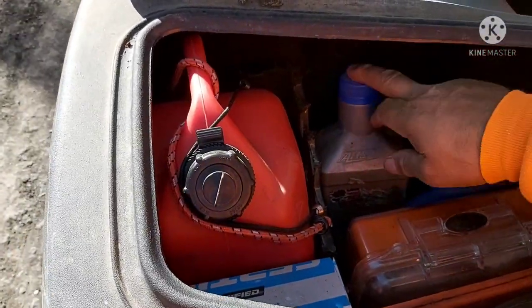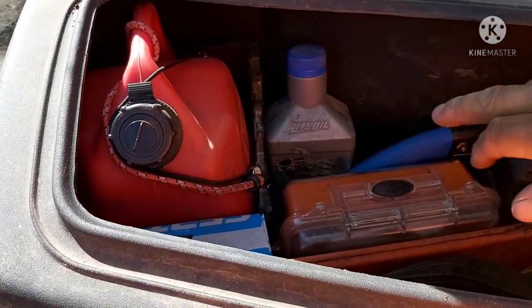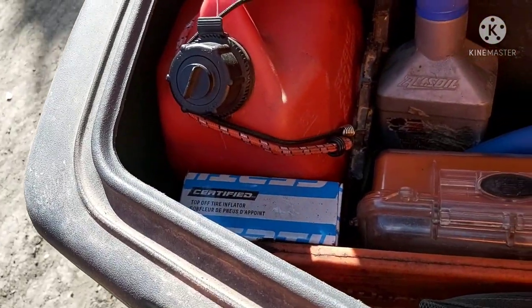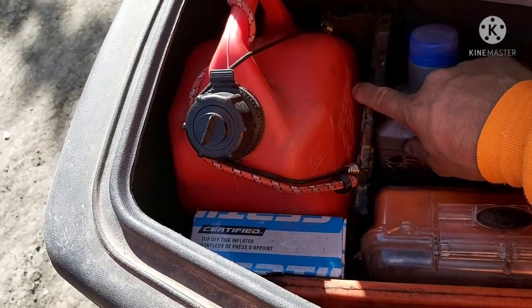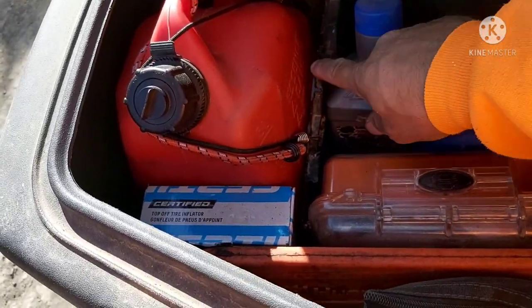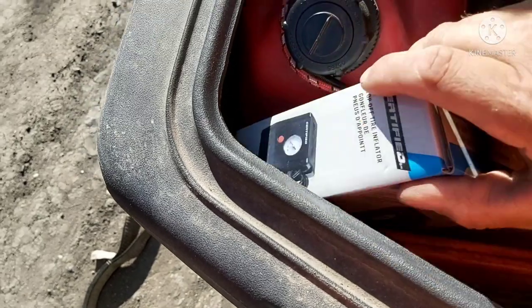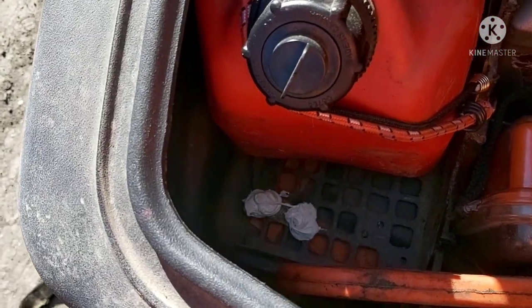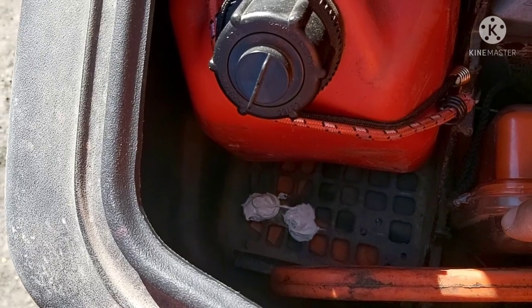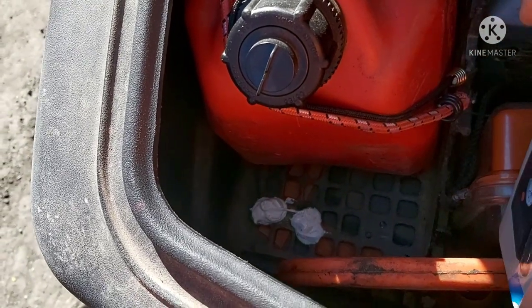Jug of motorcycle oil for the quad. Make sure it's wet clutch compatible. I did the same thing on this side with the jerry can. It's not mounted solid. I could probably put another U-bolt underneath it, but it's there. You can kind of see two jug spots of silicone, siliconed over the heads of the bolts so nothing gets punctured in here.